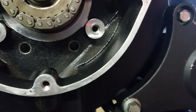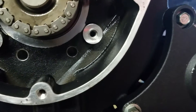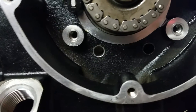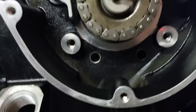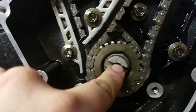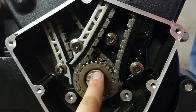In there you'll see there's going to be a little hole that pops up — right about there. We spun a little bit past it, but going nice and easy — there's that little hole that just peeked up on us right there. That actually is the front top dead center. Like I said, when you use the dowel you can slide it all the way into the crank at top dead center. When it's here on this one facing the front, that's front top dead center; when that little keyhole points to the rear cylinder, the rear cylinder's on top dead center.